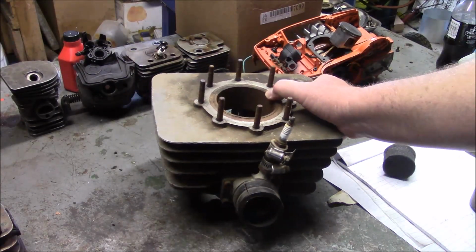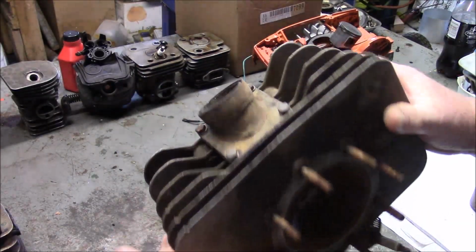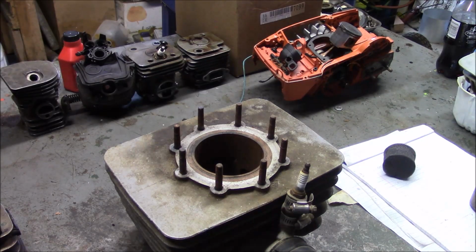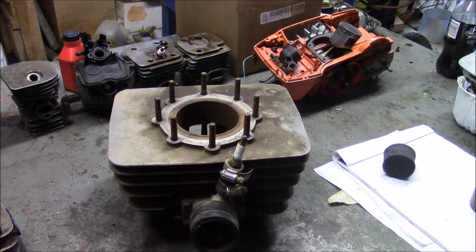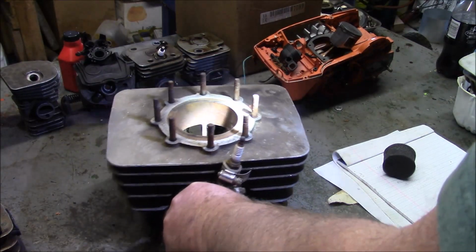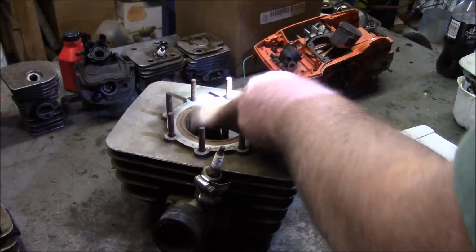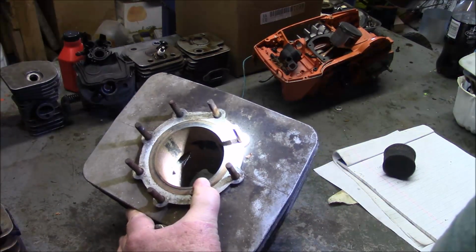Yeah, I know the motorcycle motors are square versus over square. Otherwise, bore and stroke is usually pretty close to being the same, and that alters a lot of things. But the other thing, if you notice on the motorcycle engines, is because of that they also have a lot of blowdown. I mean, quite a bit of blowdown, and that's the difference between when the exhaust port opens and the transfers. We'll get into that another day.